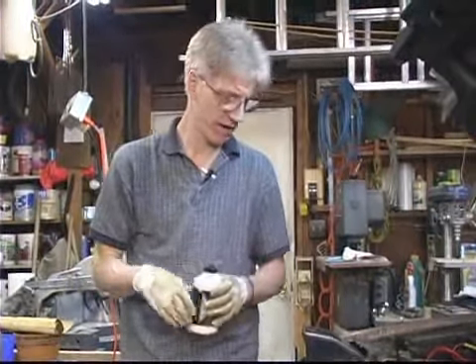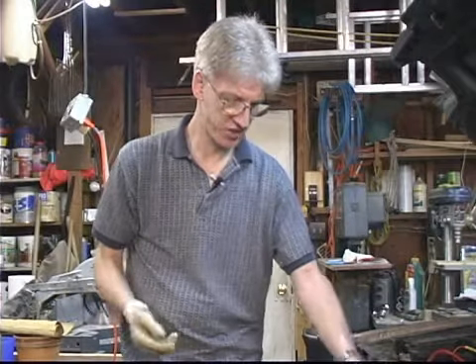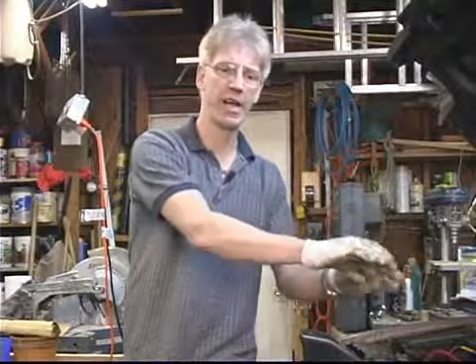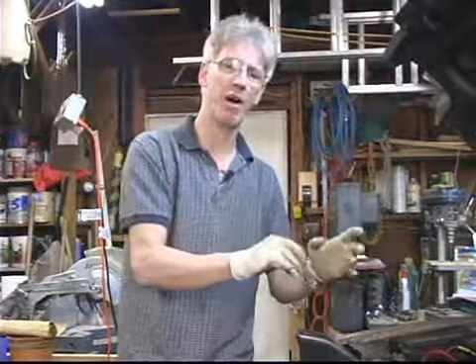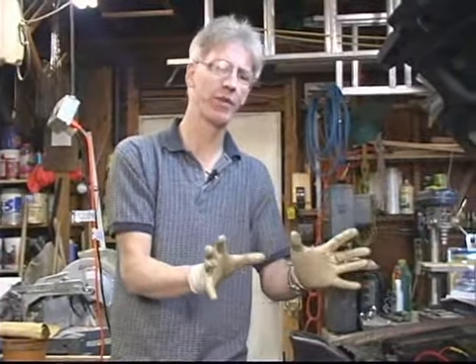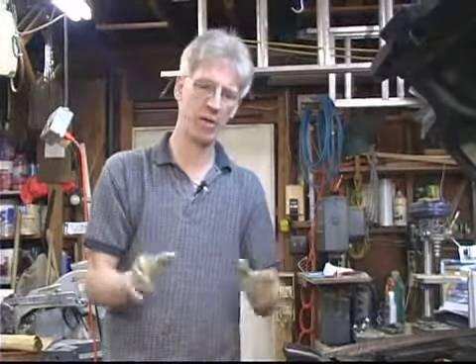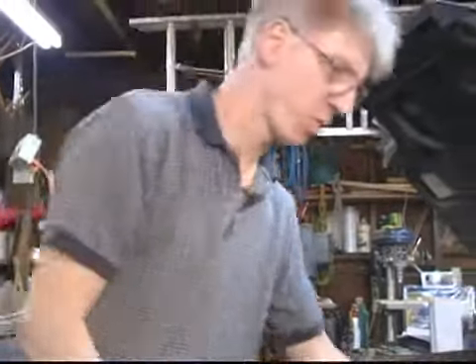Now that I've brought that issue to light, let's go back one step to the work we just did and take some brake clean and spray off where we just worked. Anywhere brake fluid leaked around there, spray it off the caliper or anything around that area, so it runs off and has time to dry up and doesn't do any further damage.